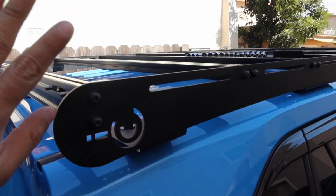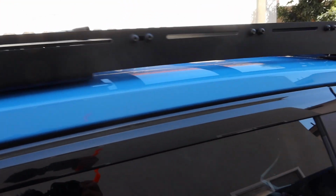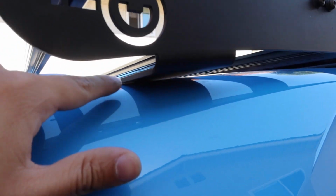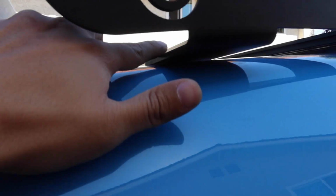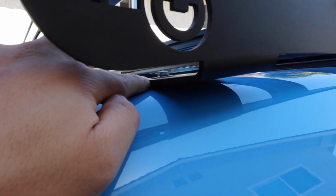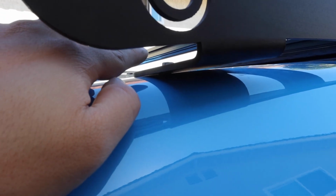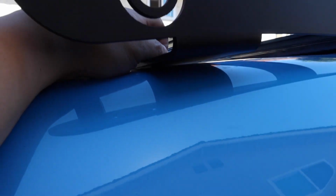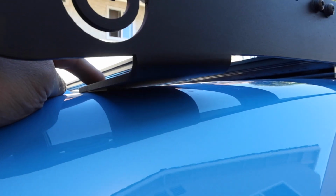First thing we're going to do today is remove the rack from the top of the Rav4. If you look closely in here, you can see I've already started removing most of the bolts. If your rack install went anything like mine, then the two rear plus nuts ended up spinning on you. So I got mine pretty tight to where it was secure, but it's definitely the kind of thing now, if I try to rotate this up here, it starts to just spin out.